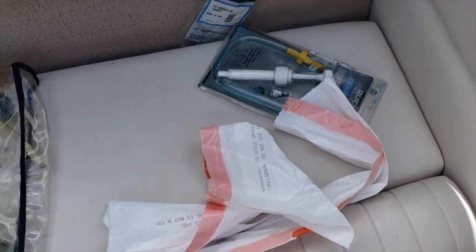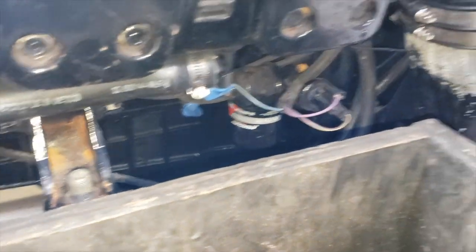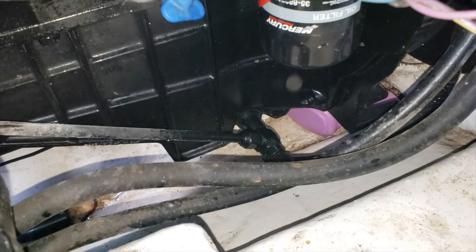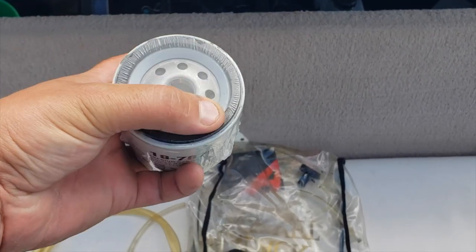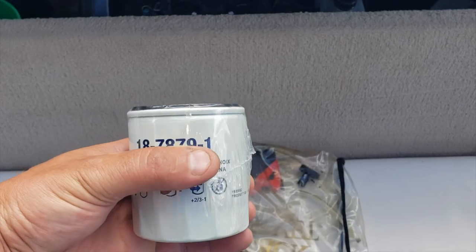The oil filter is right down there, so I put the plastic bags down there. The bottom of the dipstick is at the complete bottom part of the engine — that's where the oil comes out. Now that I've got my oil filter off, I take it out of the bag. You want to make sure you put oil around the seal and make sure the old oil filter's seal came off with the filter — you don't want it double sealed up there.